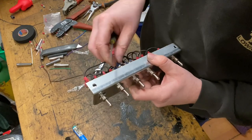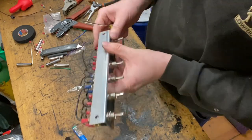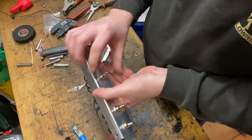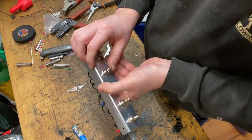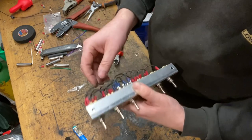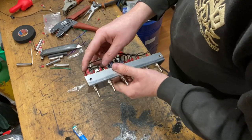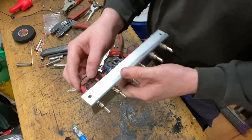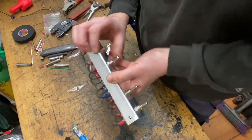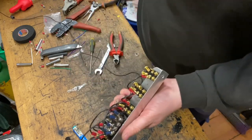I also want some more of that action to come from some of these switches. Now this fourth switch, we want it to dump the two sides. So that will dump the left side and that will dump the right side. So this is where it gets a little bit complicated. So that first wire we said would be the front left dump. So if we want this switch to dump on the up, this now needs to come down to that side.